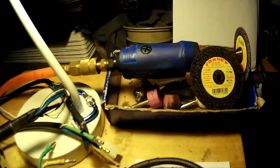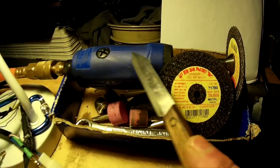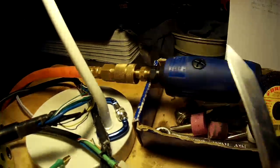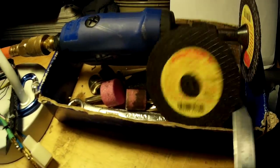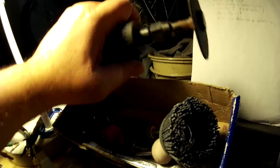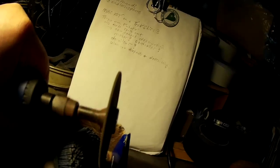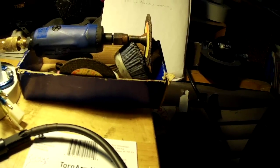In order to affect that particular repair — and here's one of the tips — I'm using one of these guys here. It's kind of a beefed-up Dremel tool. It's pneumatic. And I'm using these Forney metal cutting discs. These are great little metal cutters and you can cut any particular shape that you want.